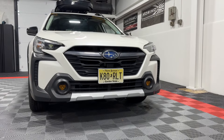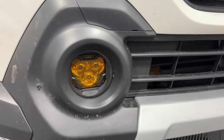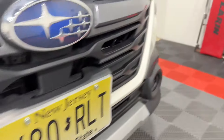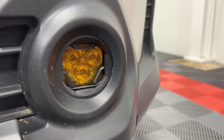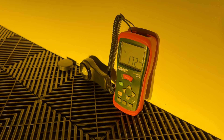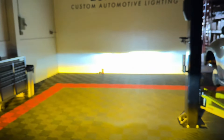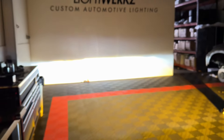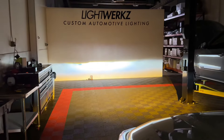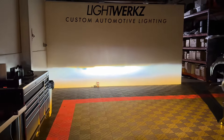Looking at the front now — you don't have that chrome reflector LED housing anymore; it's a little more rugged-looking, which is perfect for this Subaru. The fitment is perfect and looks really good in there. Unlike traditional LED pods, these are categorized by three separate LED chips — they have a unique look. Here's the lux meter at the same location as before, now hitting about 170 lux — compared to 27 before. If you want something even brighter, go with the Morimoto 4Banger HXB. The light is really well-defined and looks really solid. Let us know your thoughts in the comments below and subscribe to the channel!